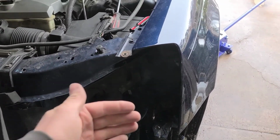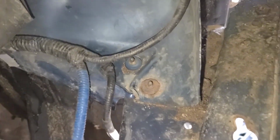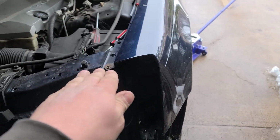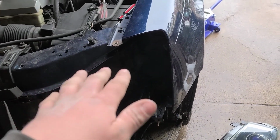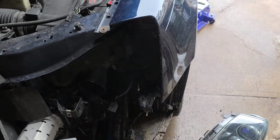I believe the fender is supposed to be out more, and they bent this in because it's really easy to do. This fender's kind of bowed out over the wheel arch a bit in order to get it to bolt up. Now, this whole panel, I don't know if it just needs to be replaced. I don't know if that bend is supposed to be in there or not, but I know that one's not. The way they had it in here, I could have my headlight projection straight, but there'd be a huge gap right here all along the side, and in order to get that gap filled up by the headlight, I got to cock the headlight like that, and that is because the bottom is sucked in, it's pushed over.